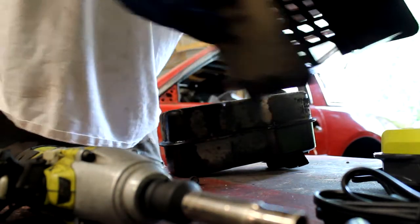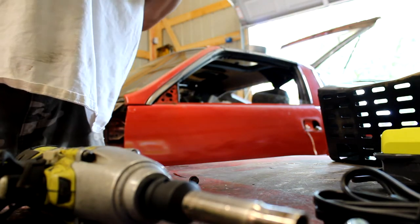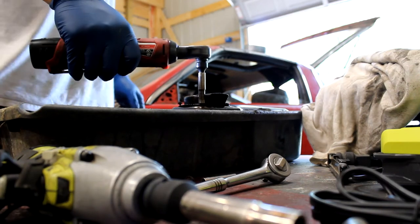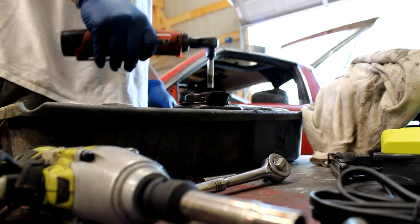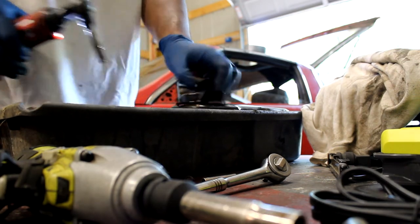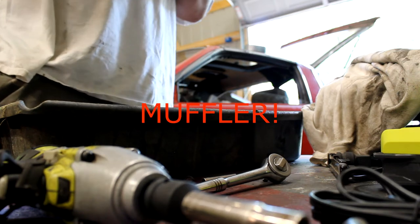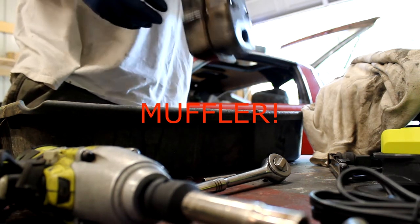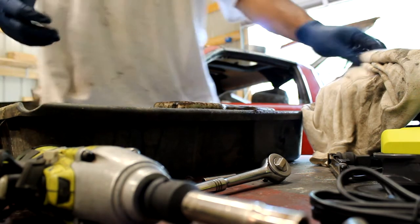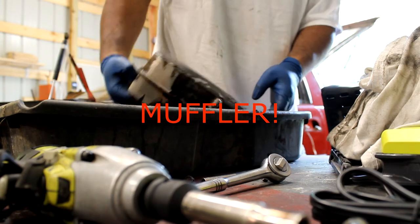There's a lot of oil in that thing. This whole thing is filled with oil — I think it's an oil breather or something. I'm going to try to catch all this oil. Maybe the breather's clogged. I'm gonna try to run it without it and see how it runs — it could just be a clogged breather.